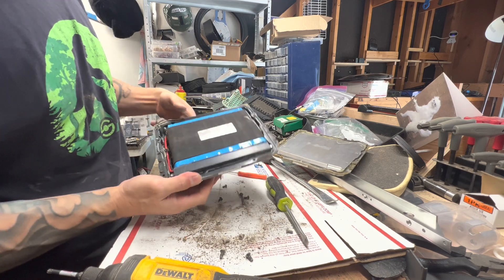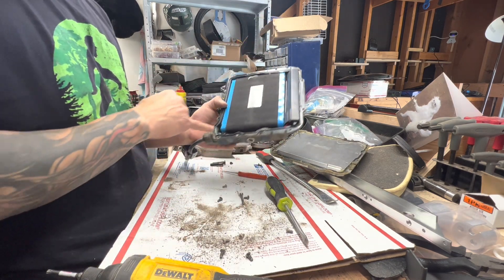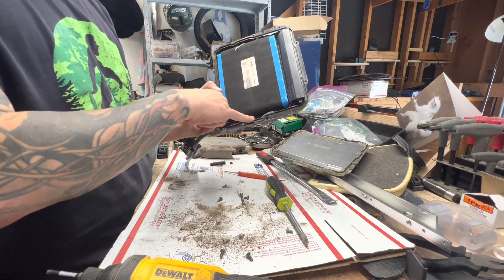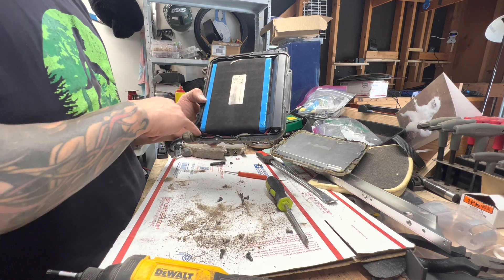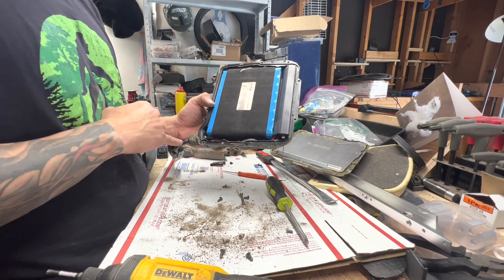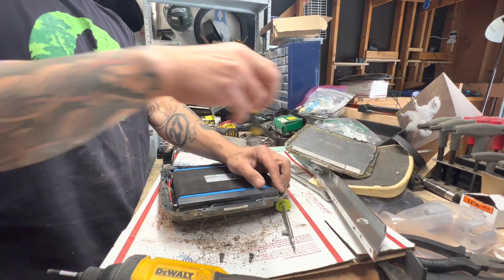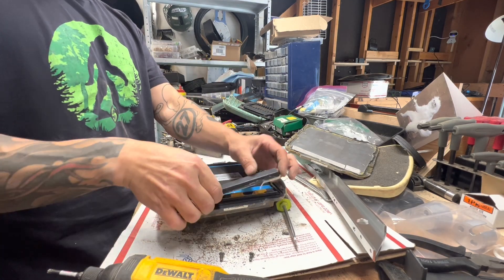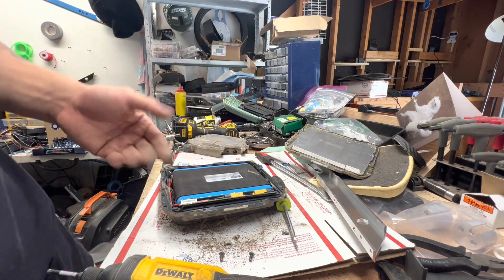There is the battery. You want to visually inspect and make sure water didn't get in there. I actually waterproofed the back of the charge ports because I have seen water get in there before. I waterproofed the inside of the gland housing there because, again, I've seen water come in there before. I've seen water come in just about every single place on a one-wheel Pint, XR, or whatever.